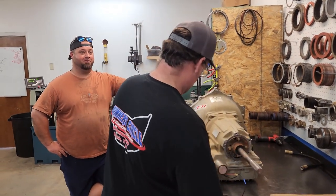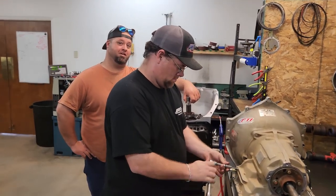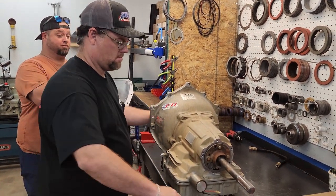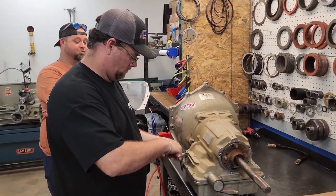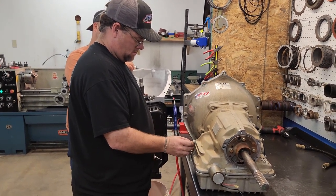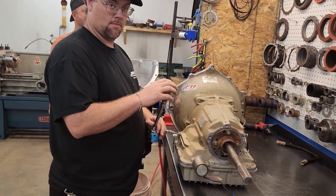I put a nitrous kit on it to step up and run the nitrous class — that was in Blue Thunder. When I tried spraying it with nitrous, it didn't have enough CFM. It ran faster off the bottle than it did with the bottle. In the Hustler we were mixing fuels — spraying nitrous with Q16 and running the carburetor with methanol. And then your Uncle Jeremy drove it the next pass and the rod came loose. It's always when Jeremy gets in the truck, something breaks.